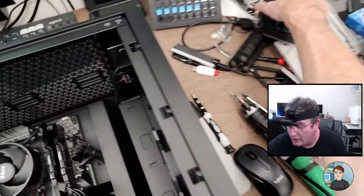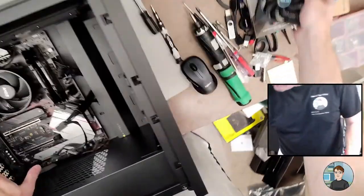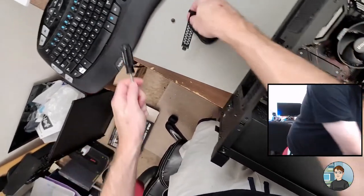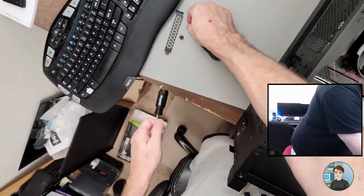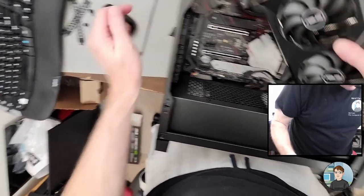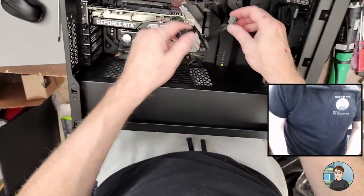All right, graphics card. So it's a 2-slot. There's the slot, so we need to take out these two covers. Faceplate goes to the left of the motherboard's edge right here, but not on the outside. Just over the slot, push, and it's in.